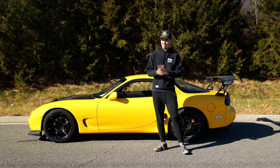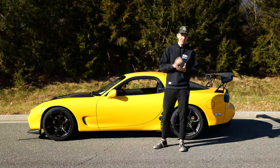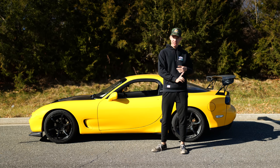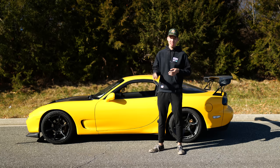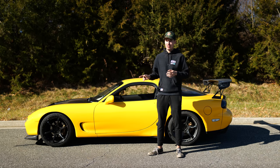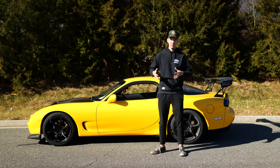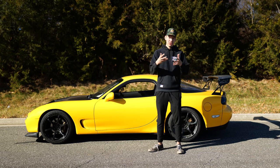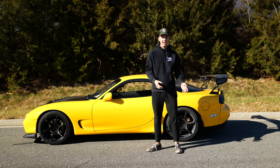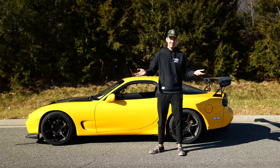That's a wrap. Not my finest work. Couple of factors, I think. Diff is really good. Shorter final drive means that I'm getting less wheel speed in first gear. So there's less inertia, less wheel speed, less smoke, and it wants to hook up. And then also I have very sticky tires. But enough excuses. It's not broken.